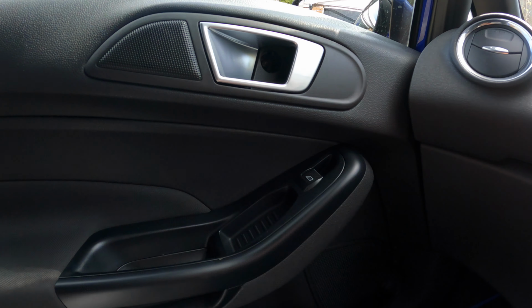That's just how things go sometimes. So finally got the airbag out. Done loads of these before at work. All you have to do is press on the metal tabs either side at the same time and it pops out. And then it just flung out and I've broken the clip. So I think I'm gonna need a new clock spring now.